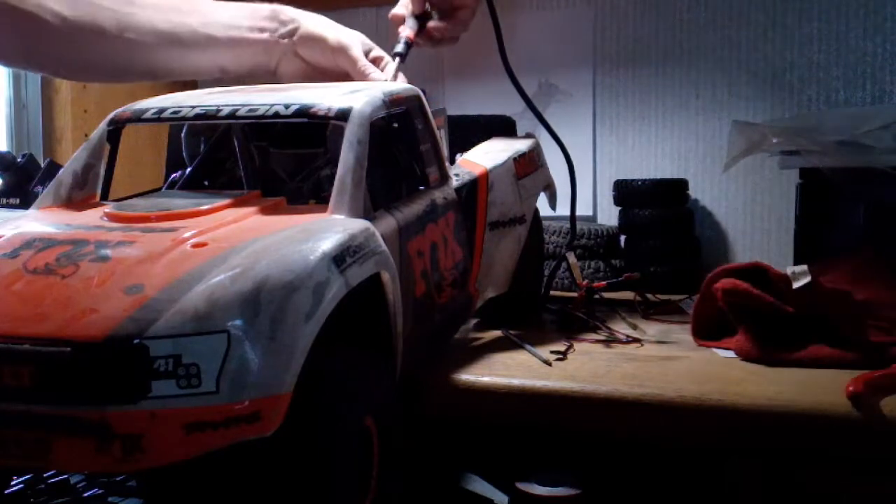Just to prove it to you guys, I'll plug in the batteries. Alright, she's on — as you can tell, no steering whatsoever. Servo's totally shot. It's not seized up, it's just not responding. I can turn the wheels back and forth, it's not locked up, it's just not responding. I might take the receiver box cover off to see if maybe it popped out and unplugged itself. There you go guys — I'm running HRB 3000 3S and 5000 in it for 6S.